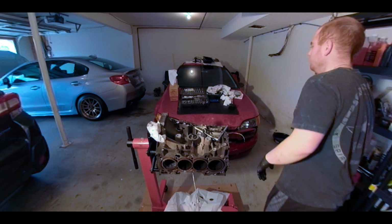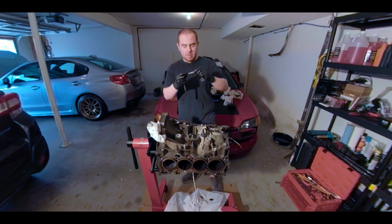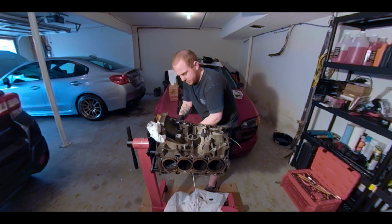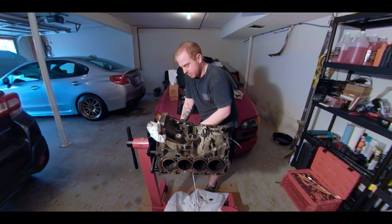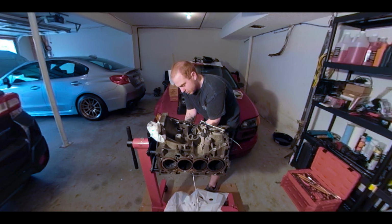So here we go. Let me set you on my handy dandy bucket. Hope it doesn't fall. Shouldn't fall. Okay, all right, here we go. All right, so like I said, here it is. You're gonna take your 12 millimeter, take those two nuts off. Be careful, because it's a lot more loose now that there's only one piston on it, so it spins quite easily. So like I said, run these two nuts off.